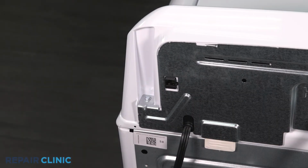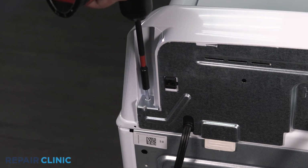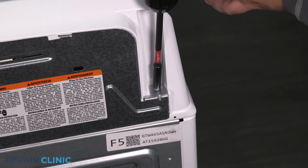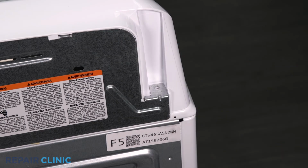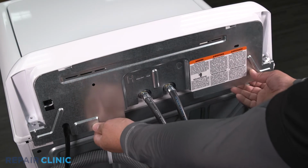Unthread the 2 screws on the panel. Any missing screws can be ordered through the links in the description below. Pull the panel out from the bottom and slide it to the right to free it from the backsplash.